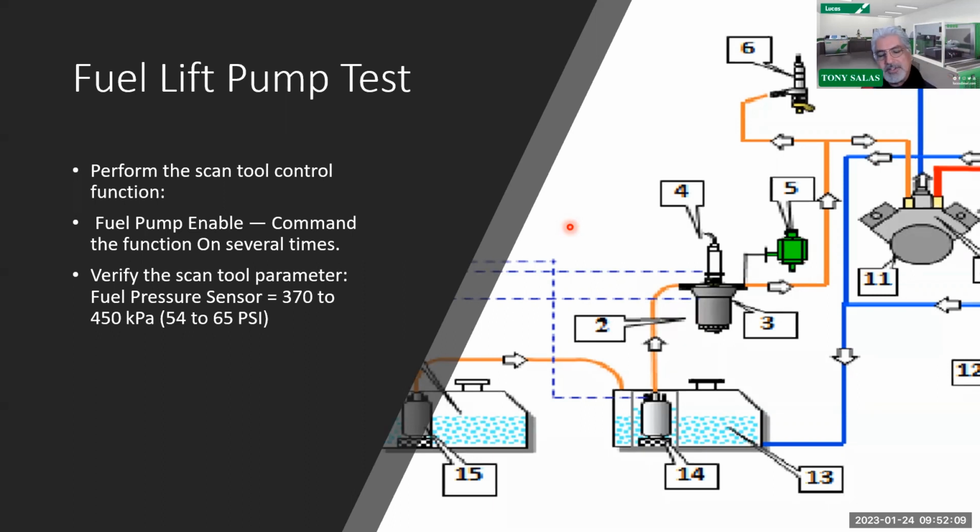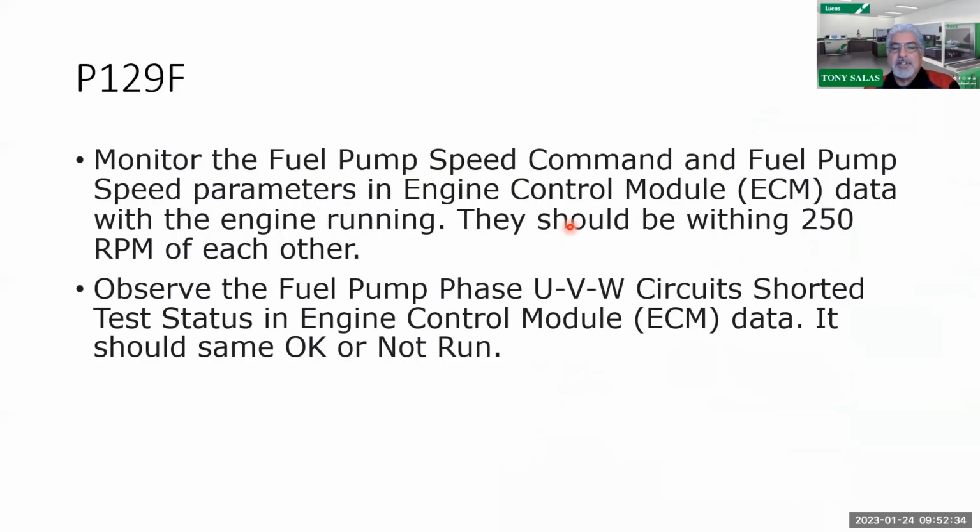So those of you that haven't noticed that, yes, that's unfortunate because when you run a regeneration, you are just cooking the diesel oxidation catalyst with the DPF. So therefore, there is a regen, but it's not heating the SCR. So if heating of the SCR needs to take place, that means you got to drive that vehicle hard or run some serious RPM on it to get it nice and hot, because that can also cause accumulation of crystallization of the DEF fluid itself that can happen.